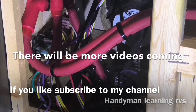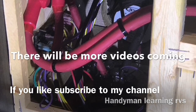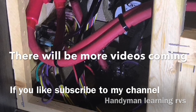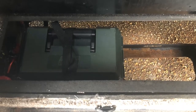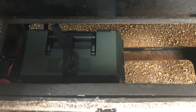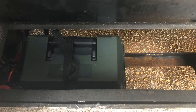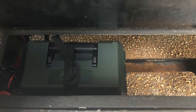I used the Great Stuff black insulation foam — waterproof — for the wires that pass through the floor. I also refilled the area where the wires pass through to the refrigerator. I still use my step location to hold a box that holds my tire pump, and I'm also going to be relocating the chassis battery to underneath the step there as well.